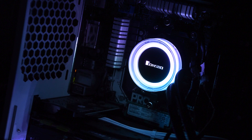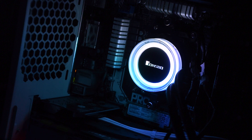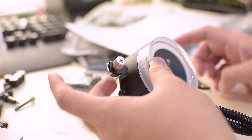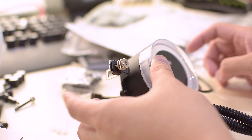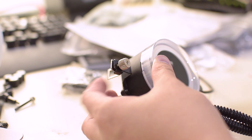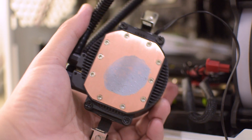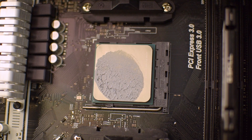The first thing I thought, of course, was maybe that the mounting wasn't really all that secure on the CPU, and that the cold plate wasn't really contacting the IHS. I think there's some truth to this, because the mounting system, at least for AM4, kinda sucks. I noticed a pretty bad spread of the thermal paste when removing and examining both the cooler and the IHS.